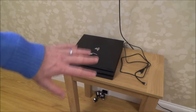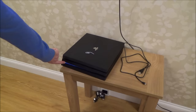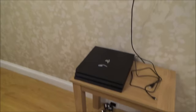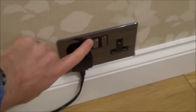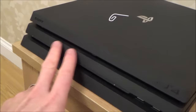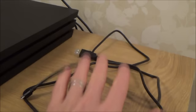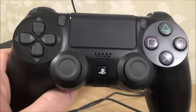If none of these cables work, try turning off your PlayStation and turning it back on again. I'm going to physically hold the power button on the console down until it beeps twice — once, then twice — and now it's preparing to turn off the PS4. Wait until it's fully turned off and the lights have gone out, then go to the power supply and unplug it for around 30 seconds. After 30 seconds plug it back in, turn it on via the console power button, then try plugging in the USB cable and the controller again. If you don't have any luck, try the reset button again and repeat the process.